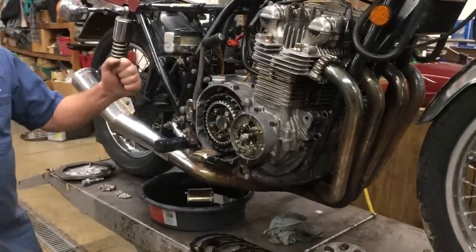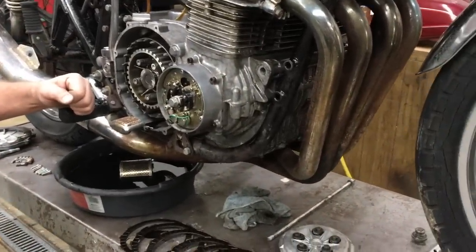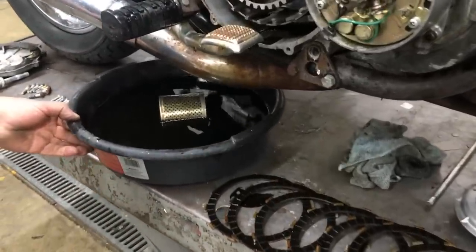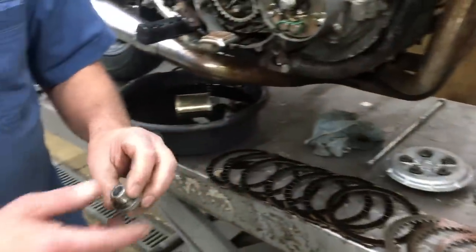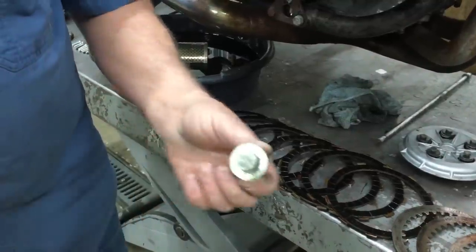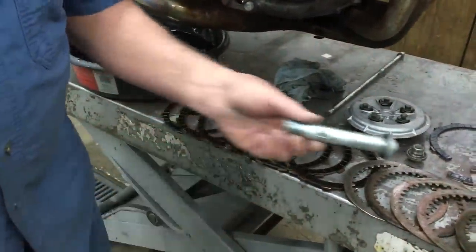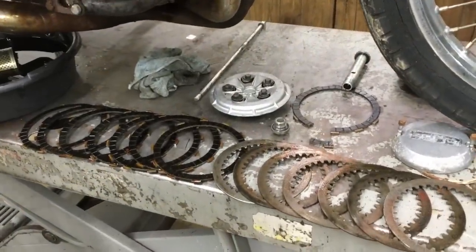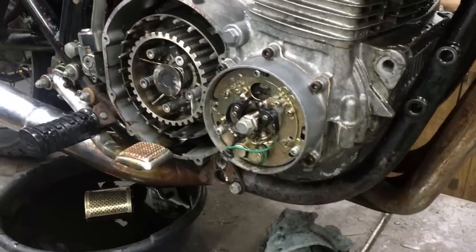Anyway, we got this bike. It's a KZ1000A. What we found so far is pretty filthy oil, as you can see. Drain plug was doing its job. Not a lot of debris on it. Cleaned that off already, but we're happy with that. The plug's not gooned. The oil filter bolt, same thing. Typical stuff. Not hardly any debris in the clutch cavity, which we're happy about as well.